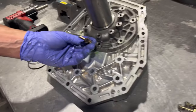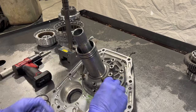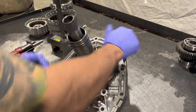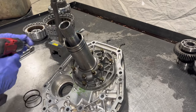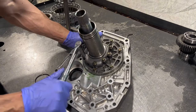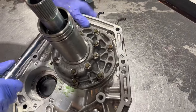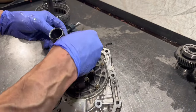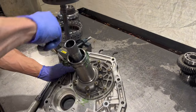We went ahead and changed these sealing washers on the pump bolts, and now we're going to put these all in. There are long bolts and short bolts — it's pretty obvious where they go. There's not a torque sequence per se, but common sense — tighten things down evenly. The torque spec here is 100 inch-pounds. Finally, we have to put these two O-rings up here, and I'm going to grease them up a little bit for installation later.